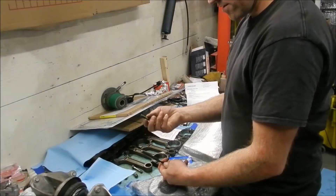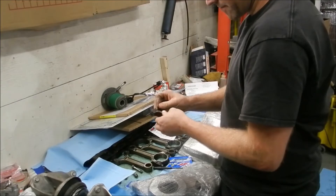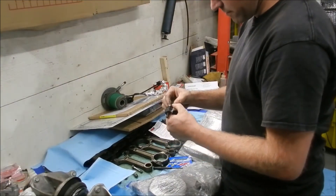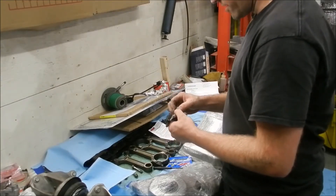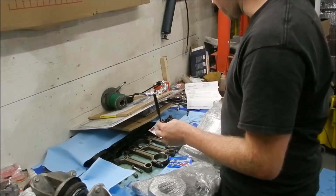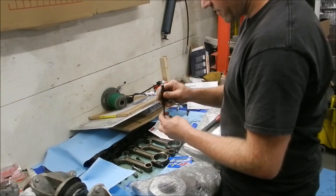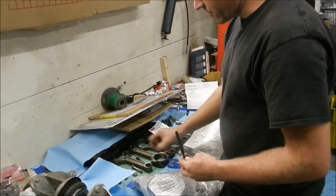Now those collars right here — those are what's keeping this bolt from coming out. The collar is smaller than the threads, so that can't come out of there. This collar is pressed into the hole of the rod. So all I gotta do is take a little punch — it doesn't take much, it pops right out. You can see I'm using a pretty small hammer, just holding the rod cap, not putting it in a vise. They come out pretty easy. So that's all it takes to pop those out — then you can throw them in the junk.